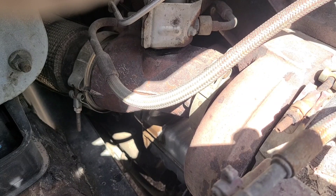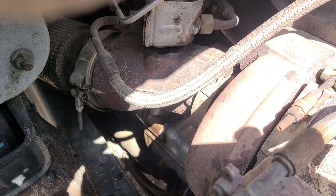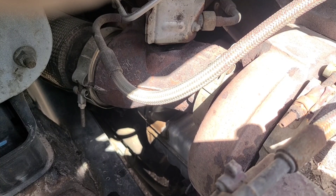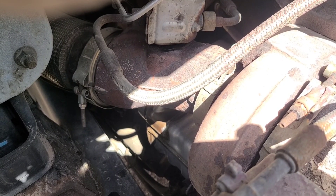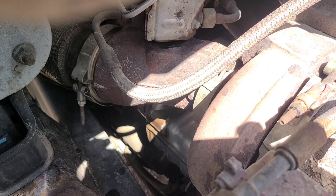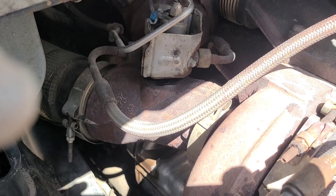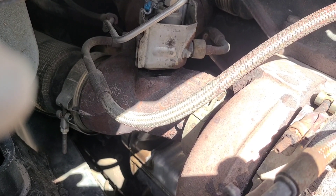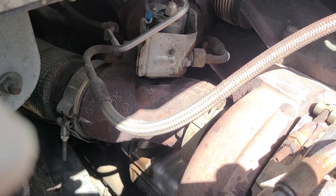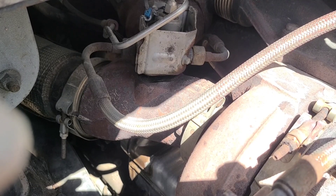When they break off, it's a pain because the valve is still on and you'd have to drill everything out, hope you can tap it and come in with a different sized fastener, or replace the elbow - none of which is good. If you're going to break a bunch of stuff, you're better off not doing the service and taking it to the dealer and having them charge you an arm and a leg. Servicing this doser valve - I did 130, 140,000 miles since this time last year, and that was the last time this truck was in here.